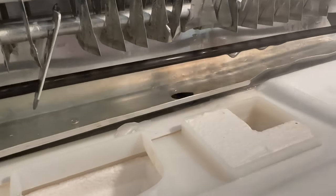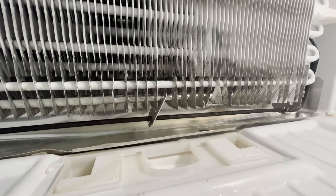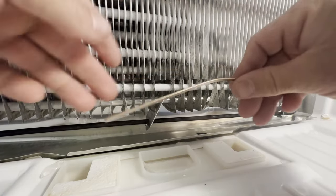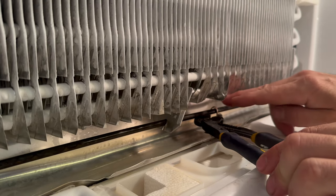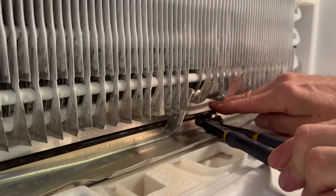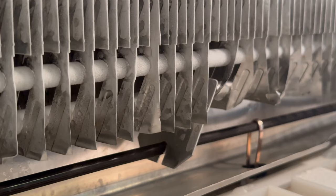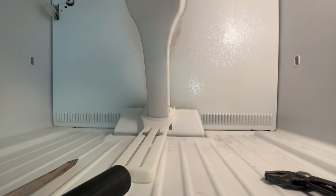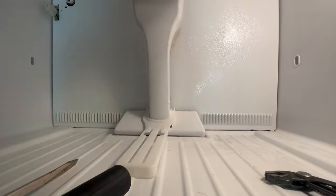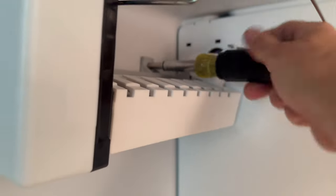Then I'm just gonna dump some water down and make sure that the water is draining. This is a manufacturer defect. They do sell extended probes that you can attach to the defrost heater for around 20 bucks. I just use a 50-cent brazing rod — I curl it around the defrost heater and shove it down the drain. It works just as well, but I'll leave a link in the description to purchase the heat probe if you don't have brazing rods laying around.